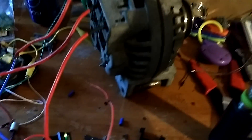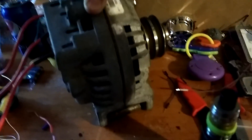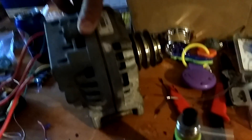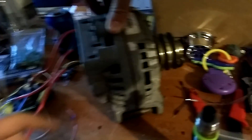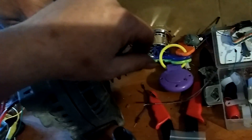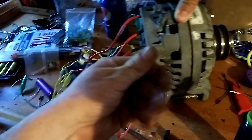There you go — running without the battery charger. It's actually quite strong, not a very high RPM but it will burn me if I try to stop it. I'm going to change this around, but there you have it — alternator turned into a motor.